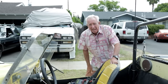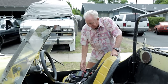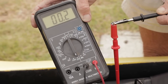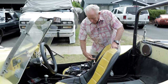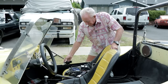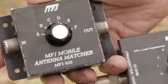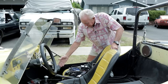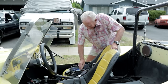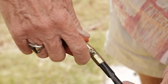You need to have some adequate test gear. It doesn't have to be hundreds of dollars worth, but we've got some gear here that you probably have hanging around your shack. First item: a continuity meter, a simple volt-ohm meter — make sure your batteries are fresh. Next, we're going to be talking about a variety of mounts and which one is going to give us the best feed point impedance. You might also need an impedance matching bridge — this one is a capacity bridge, and this one is an inductive bridge with a toroidal inductor.